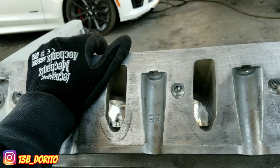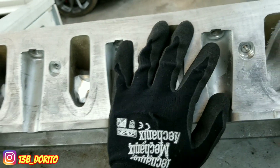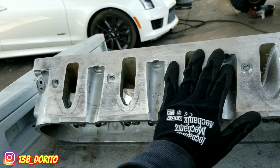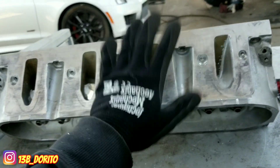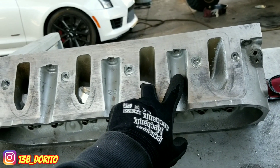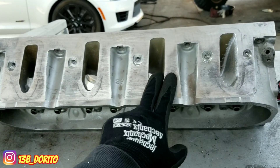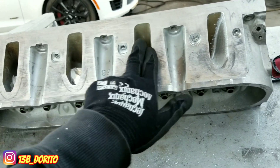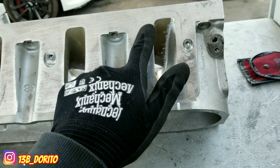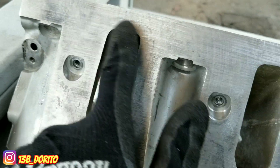But in this LS head, you have to be 100% sure — 100% make sure you have the intake you are going to use, because there are too many applications, too many cars or swaps. Like most of the porting jobs I do on the LS, it is because they are going to go to a different car, not the original car. That engine is basically going to be a swap. So if you have the intake that is going to be used, you can port much to the gasket, either on the exhaust or the intake. That is really important. So don't start making huge holes just because you see a mark on the intake — that is not the case.